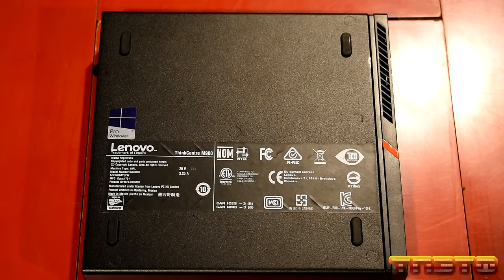So, I don't know. Like I said, I'm going to have to go look at the manual and see how this works. So, we'll be right back and take a look. Okay, guys, after looking through the manual, you have to remove the speaker and then remove the speaker holder, and then the heatsink can come off.